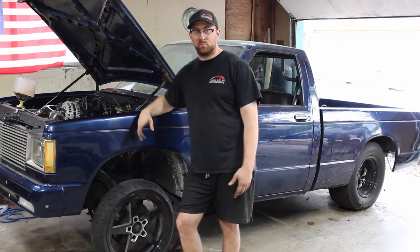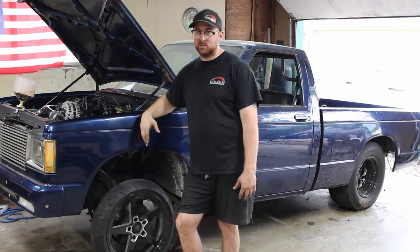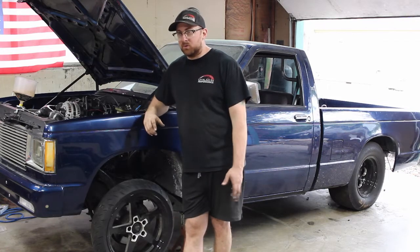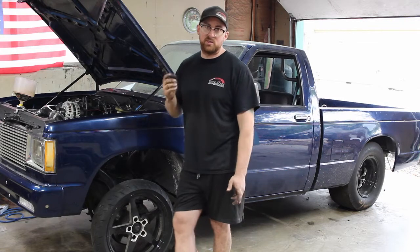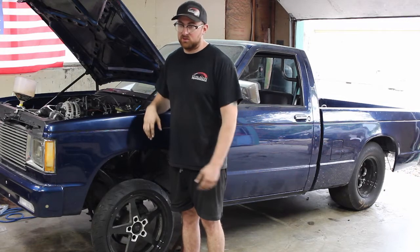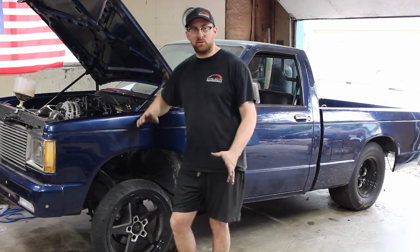You can run a forty-dollar MAC valve three-port wired in, and in theory it'll make double what the spring will make. So if the spring's at eight pounds, it should make 16 in a perfect world — sometimes more, sometimes less depending on the combo. If you want more range of adjustment, get a four-port, because it's not only adding pressure to the top of the gate but also taking pressure away from the bottom, giving you a lot more variance. They're only about 15 to 20 dollars more than a three-port.